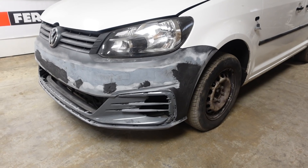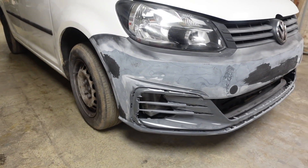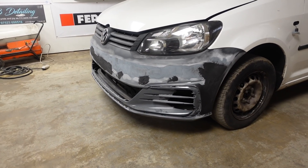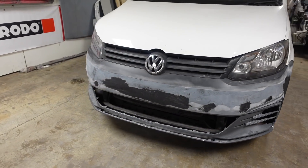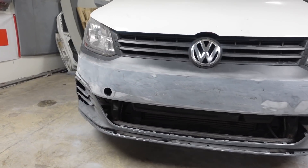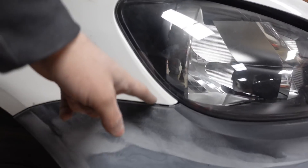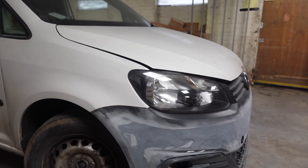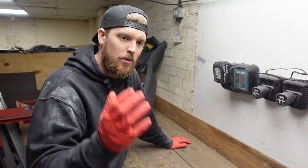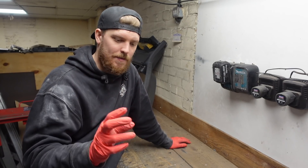We've got that round of filler all done, sanded down and sorted. I've gone and put more filler on to try and get another sand to see if it gets any better — it's probably still going to need more, but no one said it was going to be a five minute job. That is sanded down. Last coat of SMC — absolutely brilliant stuff, works like a treat. Looking mega, it's a hell of a lot better now. Next part means we need to get the bumper off and onto trestles so we can start laying the fine surface filler. All the SMC carbon fiber filler is on and finished, filling in all the deep joins and crevices.